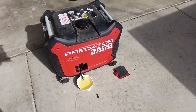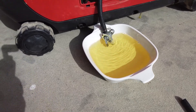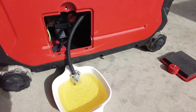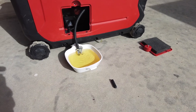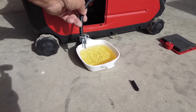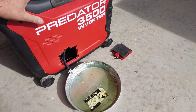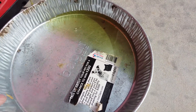Something that I noticed when I was draining this and making this demo is this fuel does not look all that great. That should not be yellow in color — that should be kind of clear. I have Sta-Bil in the fuel, but I never put much fuel in this thing in the first place unless I'm out in the field running it. So I'm getting a little concerned about this fuel — it might be getting a little on the old side, because I really haven't used this generator much since my last camping trip last June. The fuel I've drained out has kind of a yellow tint to it — that means it's getting old.